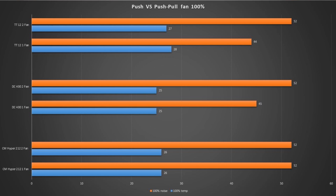Each graph shows the numbers with one fan and two fans. In the blue bars you'll have the temperature, and in the orange/yellow bars you'll have the noise emitted. As you can see, out of the three coolers, adding a second fan with the fans locked at 100% — maximum performance — there was actually no change in both the Gamax 400 and the Cooler Master Hyper 212, and there was only a one-degree performance increase on the Contact 12 from Thermaltake. So what we can take away is that you're not actually going to get a performance uplift on these budget coolers from adding a second fan. On the negative side, both the Thermaltake and the Gamax 400 saw noise go up significantly by 7 or 8 decibels each when you added the second fan.